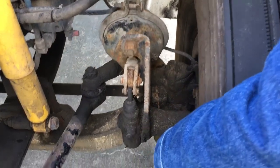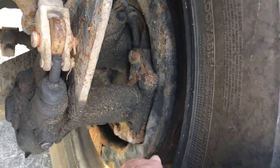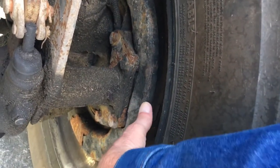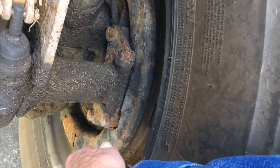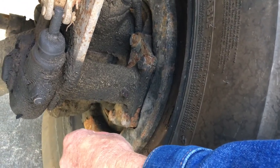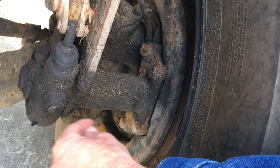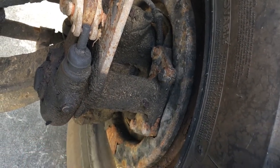I'm going to go down to my brake drum and brake shoes. My brake drum is secure. It's not excessively warm. There are no illegal welds, and my brake shoes are securely mounted, free of all grease, and have no less than one-fourth pad left on the shoe.